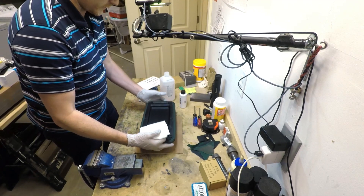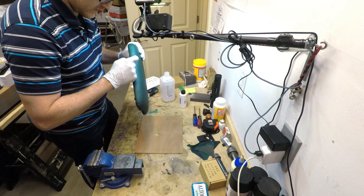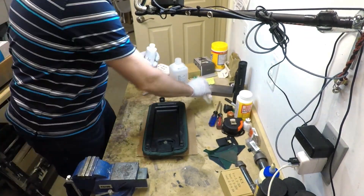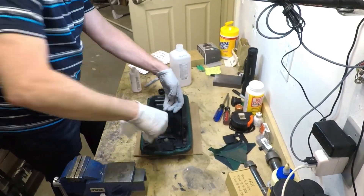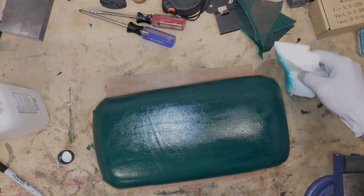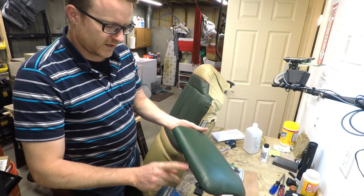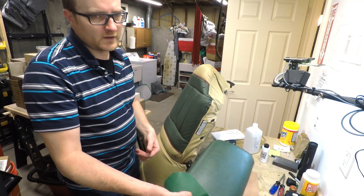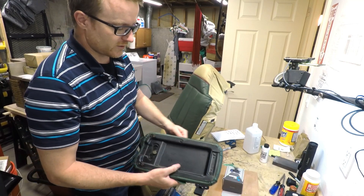Now that the dye has had some time to set up, it's time to apply a clear coat, because the dye will always remain alcohol-soluble. If I ever wipe this down with a wipe containing any alcohol content, the color will come right back out. Clear coat also just helps with general wear and tear. Here it is after one coat of sealant — I'm probably going to put on two. I can see a little bit of streaking, which isn't ideal, but it's good. It went from that to a color that's close enough that up between the two seats, where it's kind of dark in the center anyway, it won't be seen. I'm pretty happy with that; we'll see how well it wears, and if it fails, I can always just peel it back off and put on something else.